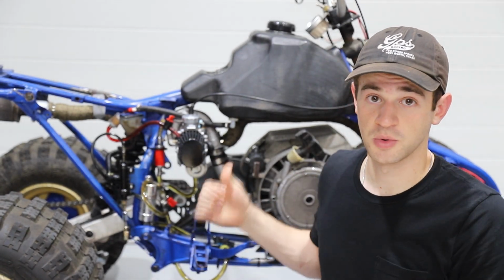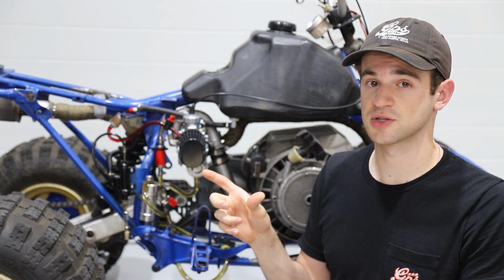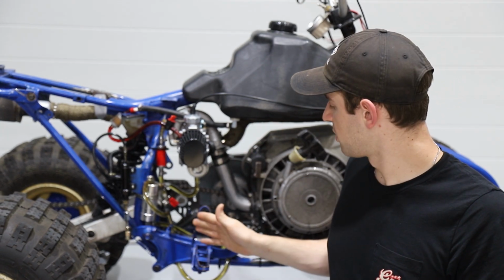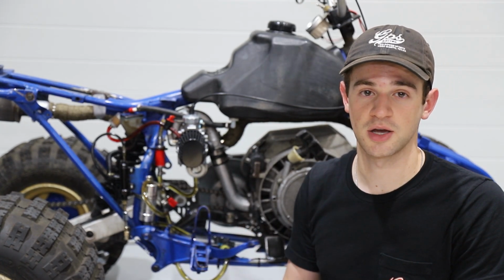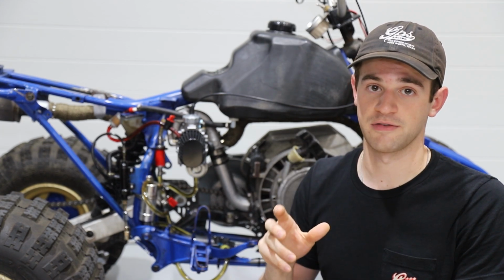So obviously we're still blowing oil through those seals and it blew through on both sides. So that lets us know that it's pushing past the carbon seal. That means our pump is running more than 77 PSI and we need to limit it down to between 30 and 60 to have our happy turbo.